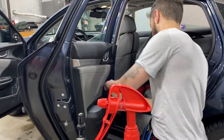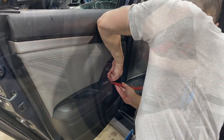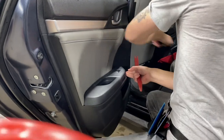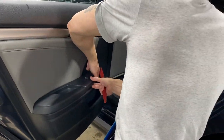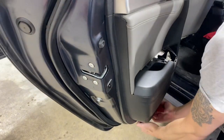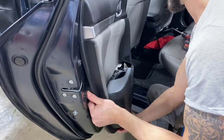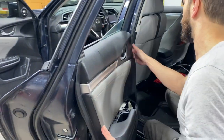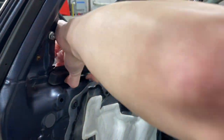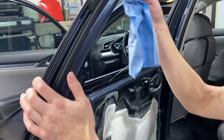The back window is somewhat similar to the front — we're going to remove the door card again using the Pry Baby toolkit and some of the Skill tools. When he pops it off, all the clips remain. He's pulling the seal here, and this is a pretty important step: even on a newer car, those tracks just get really dirty.